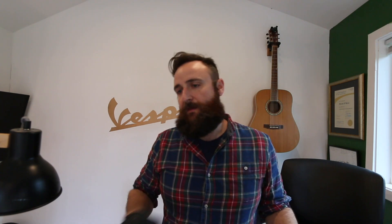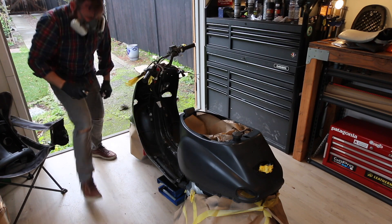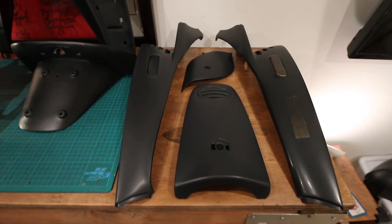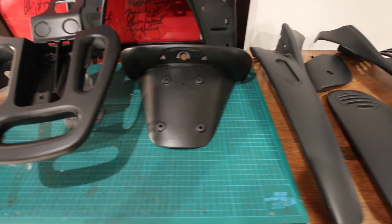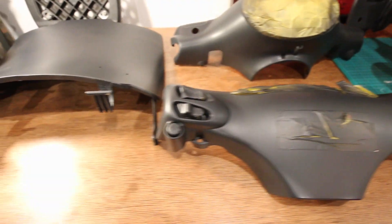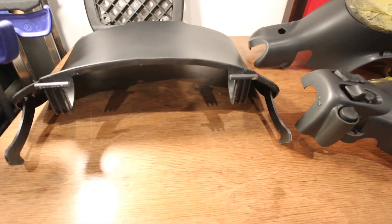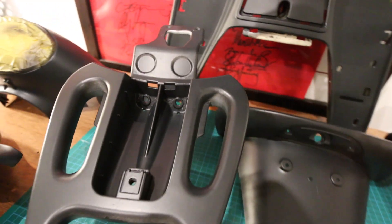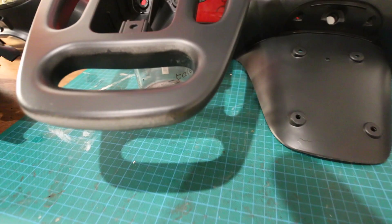So what did I get done today? A fair bit. I got the second coat of spray done throughout the bike and I'm reasonably happy with it. A little bit of spitting went on when I was doing the glove box and the leg shield area — I've got a couple of burnt-through areas where I probably had the spray can too close. It started raining during part of my primer, which is classic, so I got rain on it just after I'd sprayed the primer. I'm going to have to get some 1500 grit sandpaper before the final coat, just to get off some of the little pitting in the paintwork.